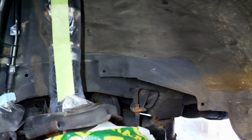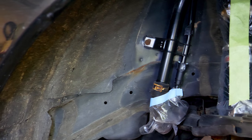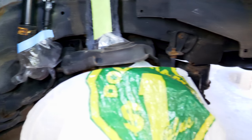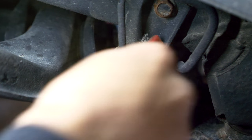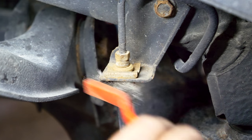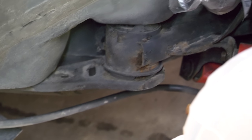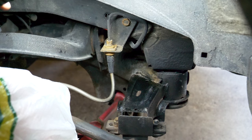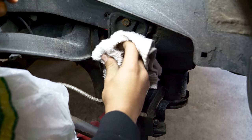The entire wheel well isn't supposed to be looking flawless now - that's what the coat of paint is going to be there for. So if there's a little bit of rust that's not a huge deal, but the more of this stuff you can clean up now the better and longer this coating is going to last. So any rust that you see, even if you can hit it with a couple seconds of a wire brush, it's going to make a big difference. Any kind of little brush, any way of removing as much rust as you can is always a good thing to do beforehand. If you can sand that area down and then clean the surface area so there's no dust or anything left, the paint is going to adhere and it's going to look really nice.